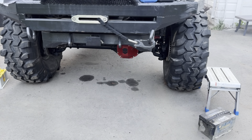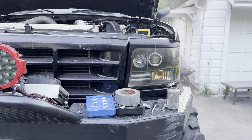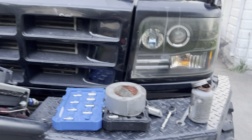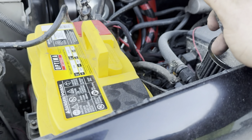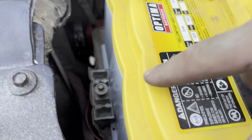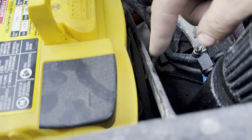Residual oil, by the way — truck was sitting on the lift for a while. Ran the glow plugs, started right up on these old Napa batteries. But then the other day I tried to crank it without running the glow plugs, cranked for an extended period — like 15 to 20 seconds — and it died. So I know there's no drain on the batteries; I know they just don't hold the charge. I got these Optimas for a real good deal. Only thing is they're not the proper size for my truck. When they're fully engaged on the lock, there's a little gap in the back. So I got a rubber grommet and I'm just going to stick it in the back — should be able to tighten them down. I got two because the truck's got dual batteries.